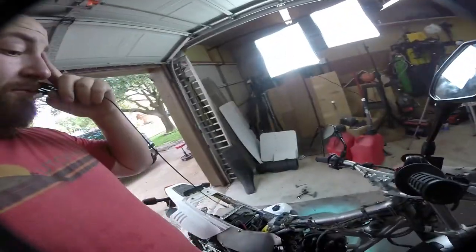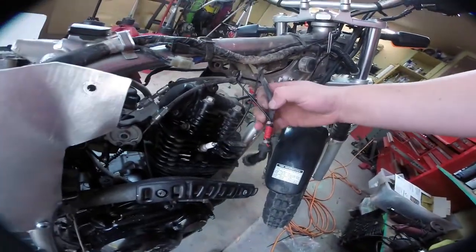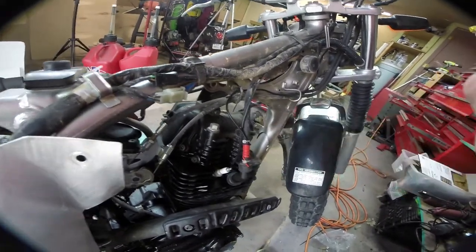The first thing you want to do is remove the tank — it just makes all the wiring easier. I usually start on the accessory end, so before we install the head unit we'll install these accessories. First thing is this thermocouple right here. It goes on the spark plug and it will measure your engine temperature. And this is your RPM sensor — we're going to wrap this around the spark plug wire going to the boot, and that'll give us a good solid tach signal. You basically just zip tie it in place and wrap it with electrical tape and it's good for thousands of miles and plenty of drops. There's our little thermocouple under the spark plug, and I'm going to wrap this up with electrical tape just so it's all black for a visual thing.